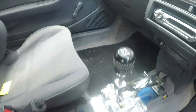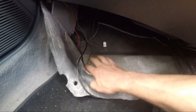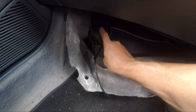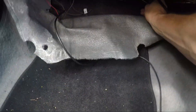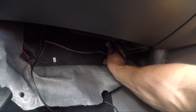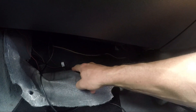The conversion harness basically goes over to this side where the ECU sits — across there and plugs into the ECU, the C101 and the A plug over there. You can see the old plugs that were on this side of the car that we didn't use, which I just poked back through.